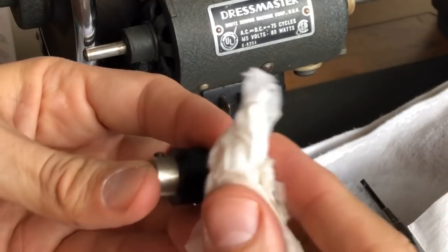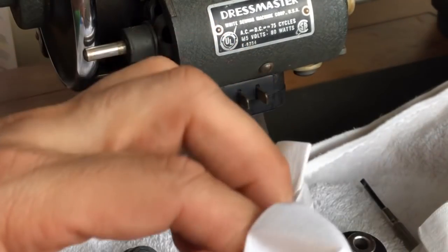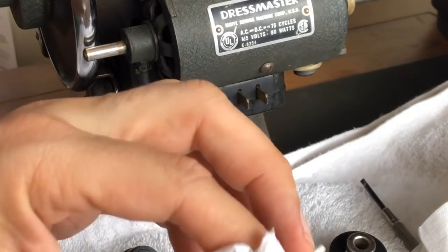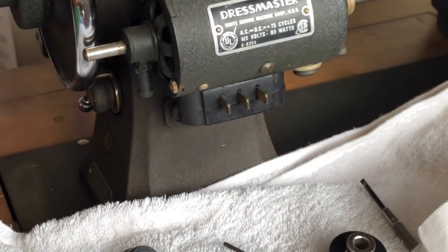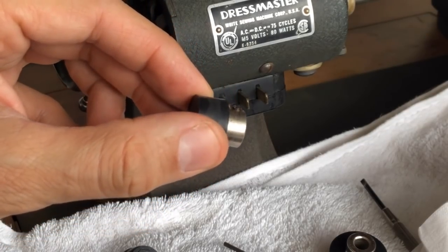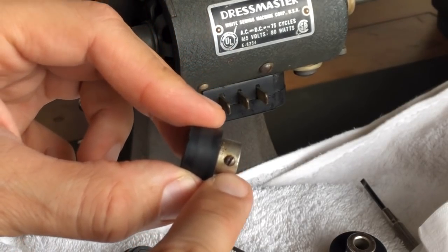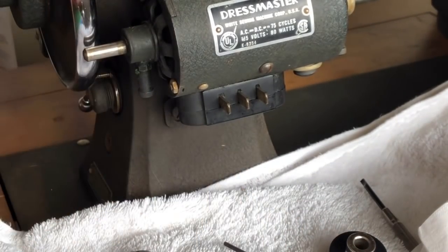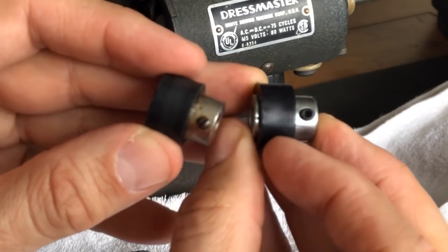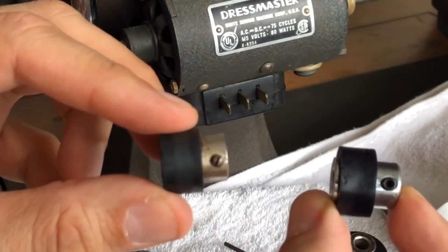A little bit of a groove has been worn down the middle of this pulley — that's okay. What you don't want are flat spots, because flat spots are going to interfere with the machine's ability to rotate and create a real problem. Because this original friction drive pulley is still good, I'm going to put it back on and keep the old straight-head screw. Some people have tried putting the straight-head screw into the new replacement — I have not attempted that because both of these function fine.